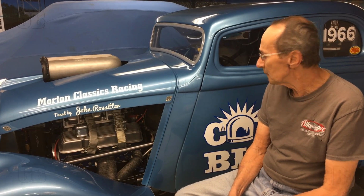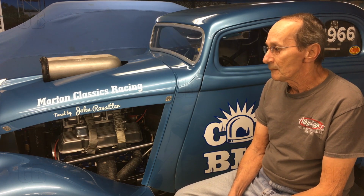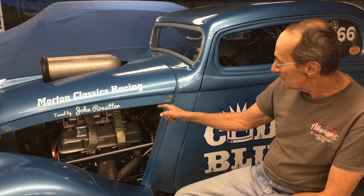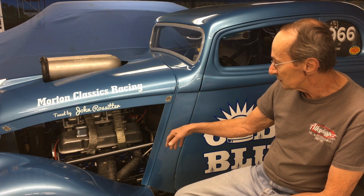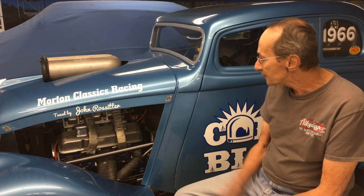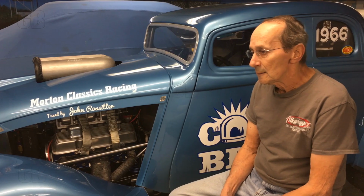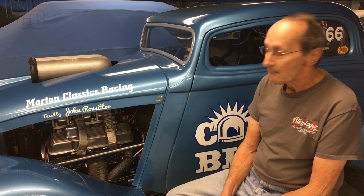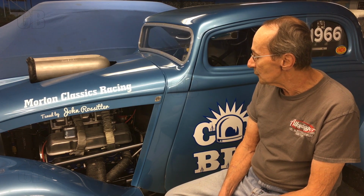Everybody. What we're doing here is a nostalgic AA gas engine build, kind of period correct, sort of like back in the day. The guidelines that we're following basically are from the Nostalgia AA Gassers Club. Some of the highlights of that are cast iron block, cast iron heads, 671 blower, no funny business inside of it, typical bottom outlet opening, no high helix rotors, magneto, 20% overdrive, alcohol allowed, and maximum of 500 cubic inches, and that would basically encapsulate.